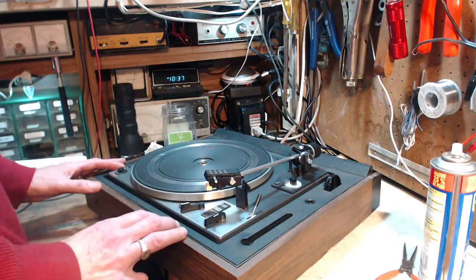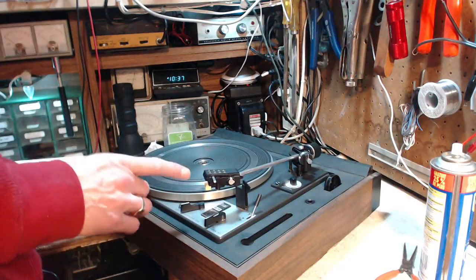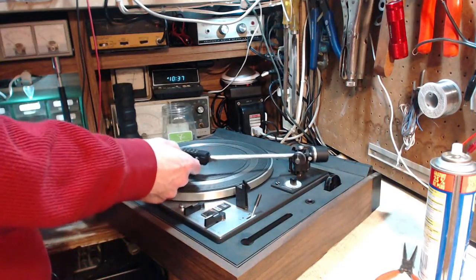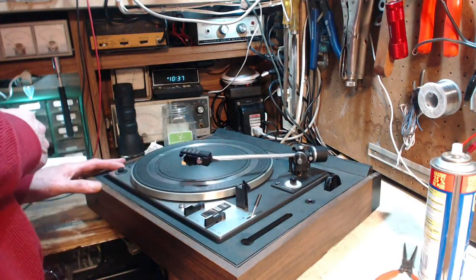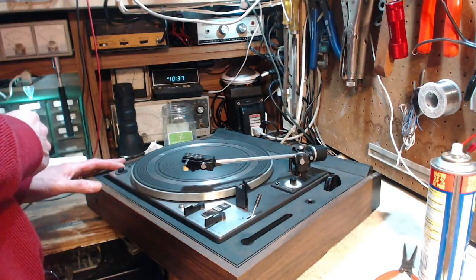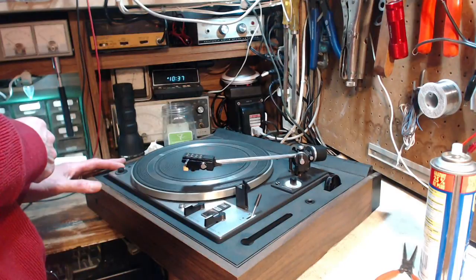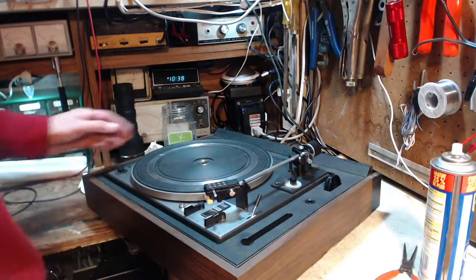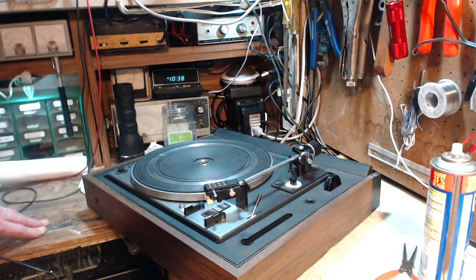Came up a lot higher. Just maybe a wee bit more. Look at that. Halfway back. Okay, so the next issue with it is that the top hat is shrunken. The little rubber piece needs to ride higher on that post. So I need to do something to make that run just a little higher and yet not get rubbed right off the top, because there's not enough left on the post to hold on.